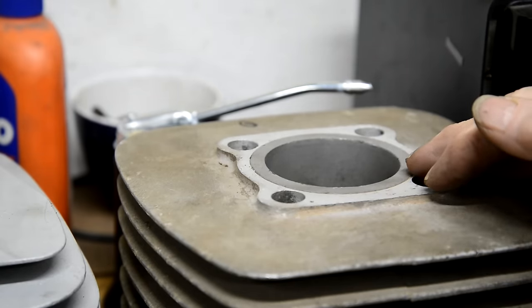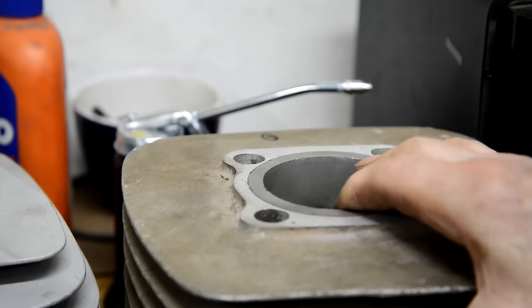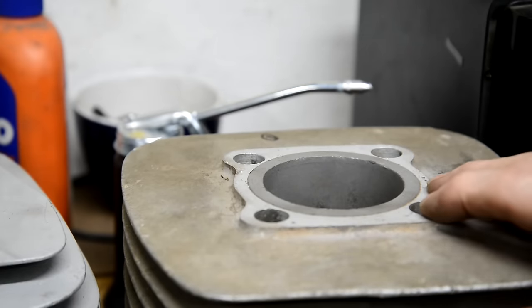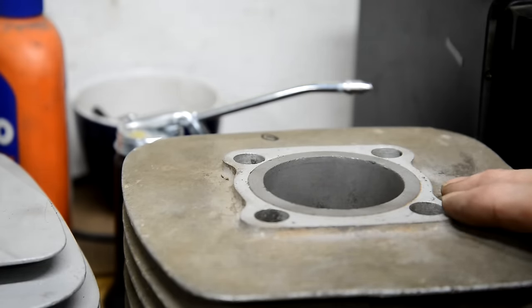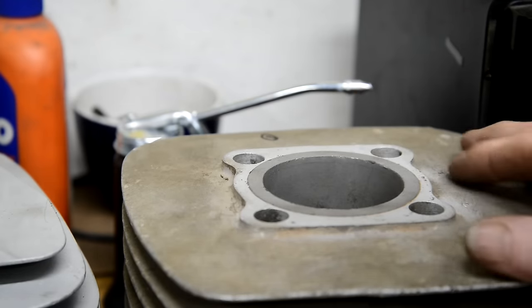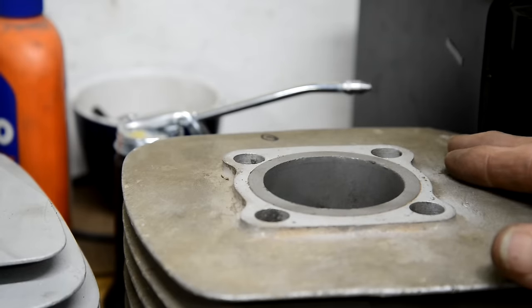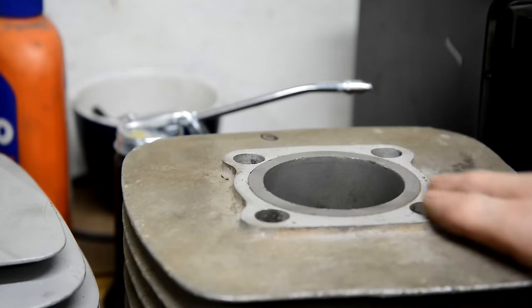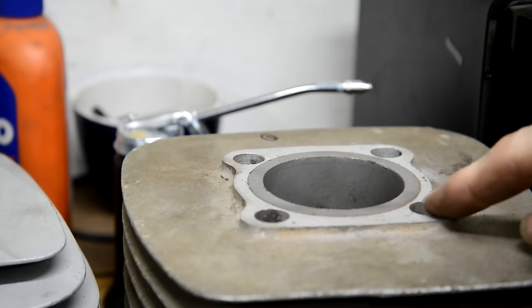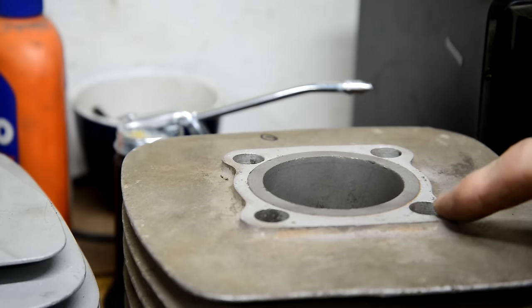and I think it's too tall for me to do it in my mill. Steam Shop should be back from Florida soon. He generally comes back in April. So I'll get this barrel cleaned up and see, you've got to have, no matter what people tell you, you've got to have the piston to do a rebore.